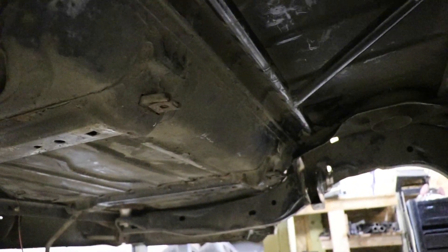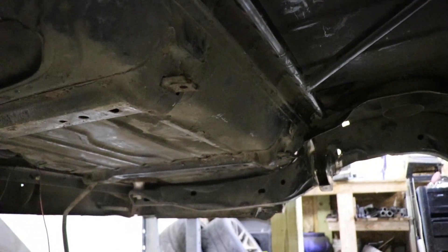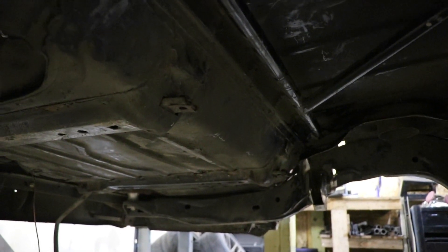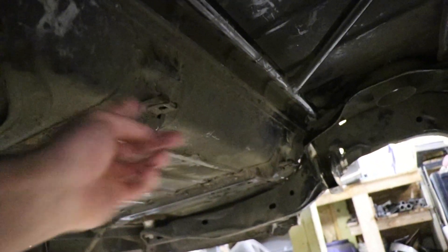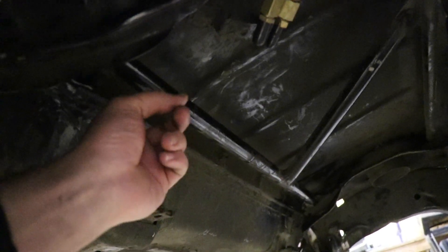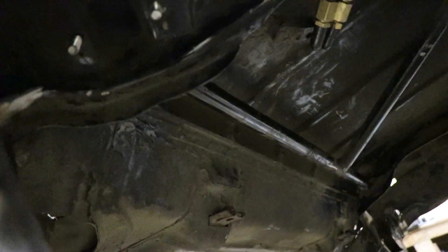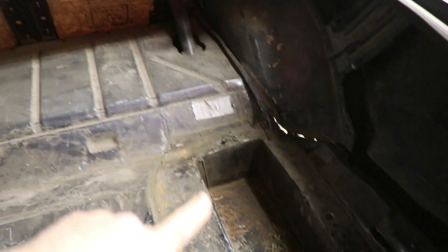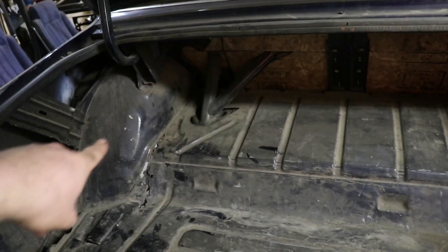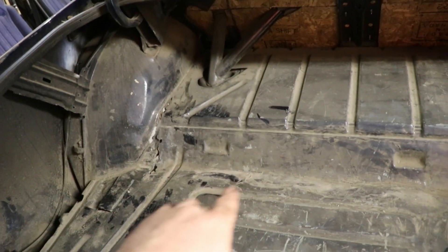The plan is to put a piece of angle iron across that doubles up on the gas tank mounts, and then I'll just weld it right to the frame. I'm able to do this because the body is on solid body mounts. By tying in and making another cross brace, I can cut the existing one out of the way to give clearance to the three-link bracket, and it will rigid-mount the gas tank to the chassis. I'll also patch the seams and reinforce it across the top, and fill the holes to keep it clean back here.